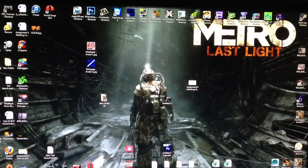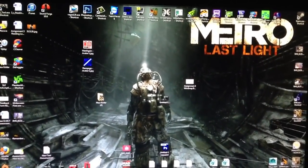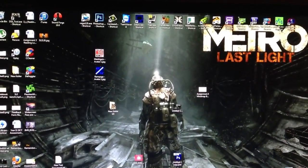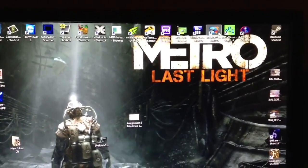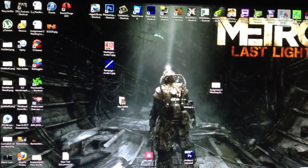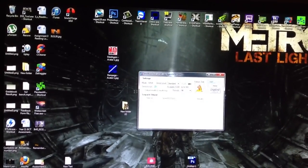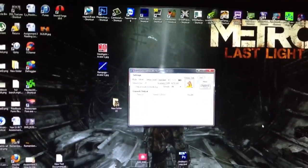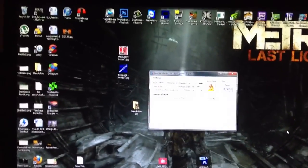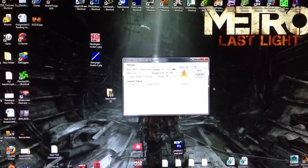So I'm not one of those guys that go, oh, your overclock's not stable if you haven't done 24-hour testing or 12-hour testing. I just find that's ridiculous, because any of these programs, such as Intel Burn Test or Prime95, they both use unrealistic loads to determine errors. So if you're getting errors while doing this, then that's when you have problems. If you're running Intel Burn Test or Prime95 and your computer either blue screens or whatever, then yeah, that's not good. So I'll just quickly do 1 pass.